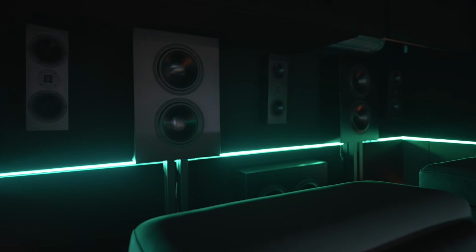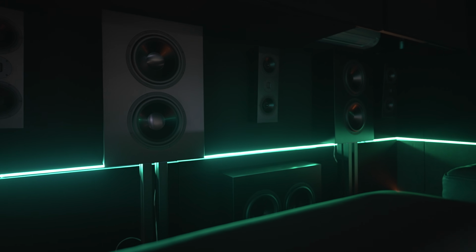And what I think made the biggest difference between this latest calibration with waveforming and my very first one was that for the first calibration, I had the two corner back subwoofers on the floor. For the last calibration that I just did, I elevated the subwoofers so that they were in the middle of the wall. And I think that really made the biggest difference with the coverage and the frequency response.